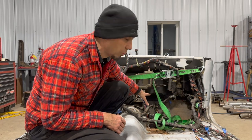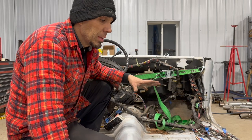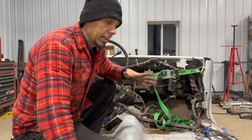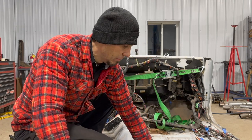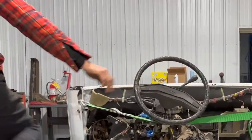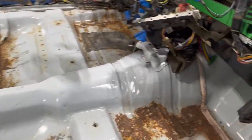The next thing I'm going to do is get in here and remove all the insulation on the firewall, floors, and kick panels, because I don't want any fires when I start welding soon. Once I've finished welding and the cab is where I want it, I'll spray some rust inhibitor, put seam sealer in all my seams and welds, and then put sound deadener back in. Once the project is complete I plan to do carpet and things like that. For now the stock insulation has to come out. Looks a lot more cleaned up and ready to receive a cab — and a lot less likely to catch fire.